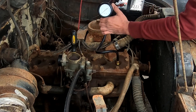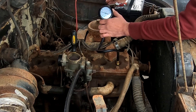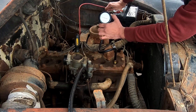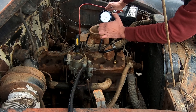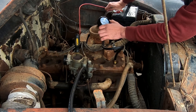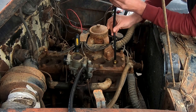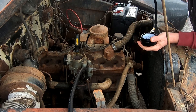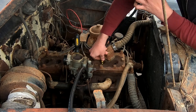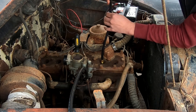That's not very good — 65 psi on cylinder number one. You want to get about four compression pulses from the engine, so crank it around four times then let go of the starter. If you only do one or two cranks it may not come up as far as it will, but it'll reach a point and stay there. The spec on this engine is 130 psi, so we are very far down. You need at least 90 to 100 psi to consider it runnable.